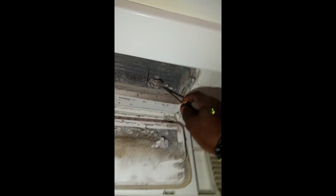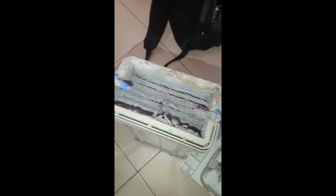So this dryer was in a bad state. It's quite an old dryer, 29 years old. She was given this as a wedding present. So if your dryer is not functioning properly, maybe it's taking long to dry, consuming a lot of electricity, it could be related to a service issue. So she had cleaned the lint filters that were very clean. But the condenser was clogged. Extremely clogged. But the dryer should still work anyway, but it will take time and won't stop after 2 minutes.